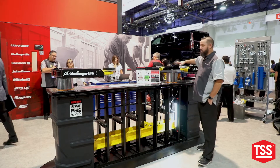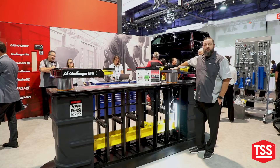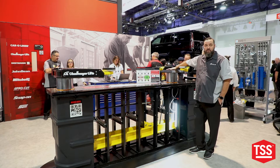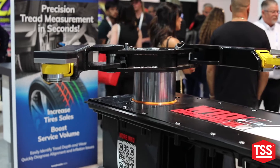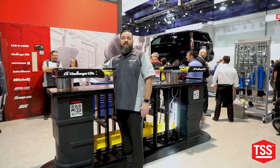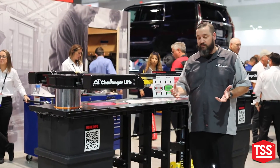As you'll see right here, this was our old standard in-ground and the biggest difference with the batteries that we are having to pull out of the bottom of vehicles nowadays is that you used to have to drive over the bolster beam. So what we've done to accommodate that is we've come out with the new wide in-ground, which has a different superstructure — you're now 88 inches between your barrels, which allows enough space to be able to drop the battery out of the bottom of the vehicle.